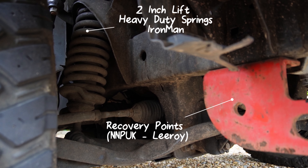Storeb Unlimited Bushcraft asked about the lift kit and what to expect cost-wise. You can expect to spend around a thousand pounds on a good lift kit — that gets you new springs all around. Extended shackles do give some lift but put a lot of strain on existing springs. I've used the Iron Man two-inch heavy-duty lift kit: a five-in-one leaf spring setup in the rear and coil springs with nitro gas struts up front. It gives great load control, is comfortable off-road and on-road, and has really improved stability. I've also installed a two-inch body lift. Budget around £500 to £1,000 and upwards depending on vehicle.